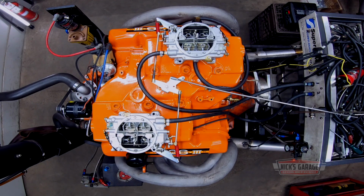160. Okay. Hey, we're back up. I told you that the timing is where it is best. Yeah. It's 36, 37 degrees. The mark that you put initially, it's right on. That's the spot. You got it. Okay, here we go. Hey, we're looking at 560 foot-pounds of torque. 550 horse almost. Yeah. That ain't bad, man.